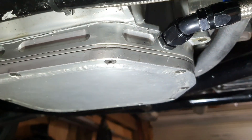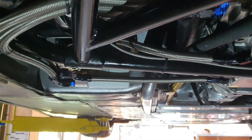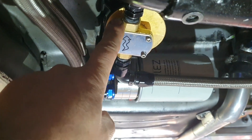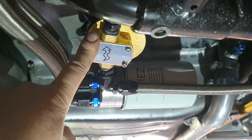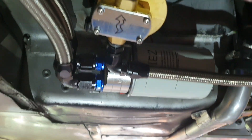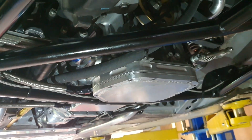The pump return goes through the hose into the bottom of the sump — not ideal, you'd normally pump it in above the oil level, but I don't want to take the sump apart right now. That's where it'll be for now; when we rebuild the motor with the new pistons we'll sort it properly. The pump instructions say never run it dry — but with the return going into the sump at approximately oil level, there will always be oil in this hose all the way to the pump, so the gears will never actually be dry.